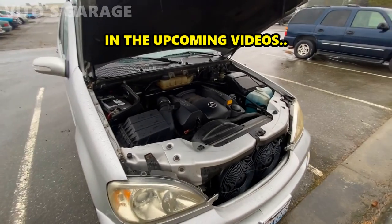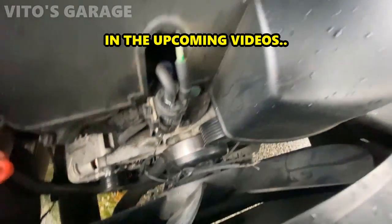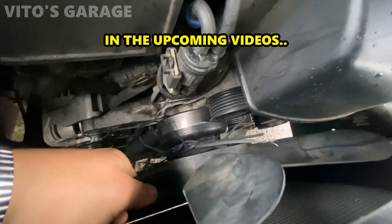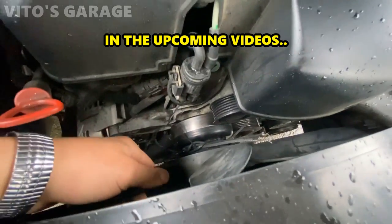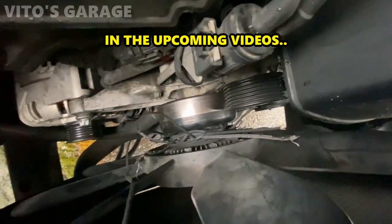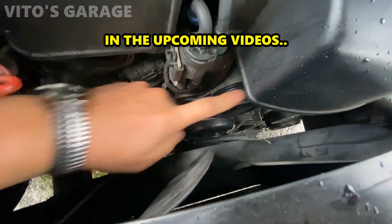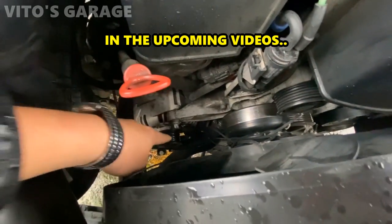This is the next day — I opened the hood and here's the damage. This is the water pump and there's so much play in the water pump bearing. That's what caused the belt to come off and get shredded. I checked the rest of the pulleys — they're all fine. This one is just making a noise. The alternator I replaced — I'll just keep going with the repair.